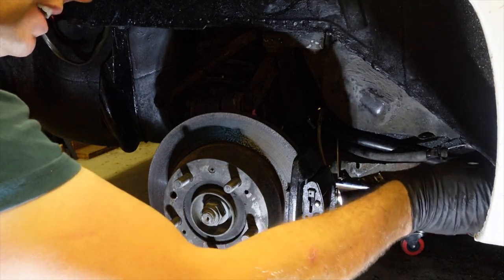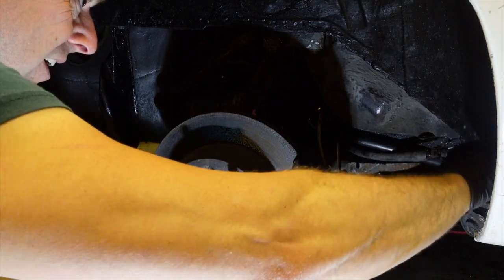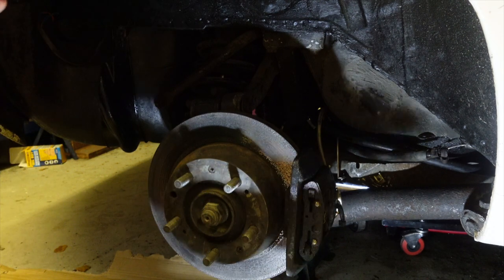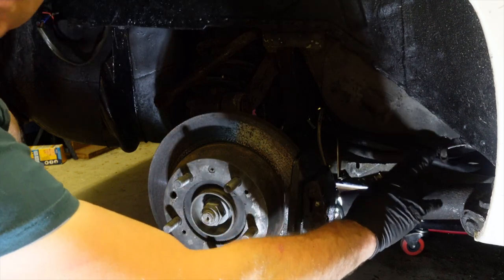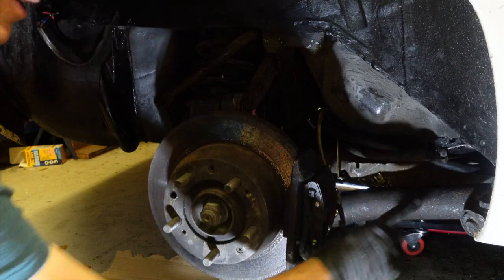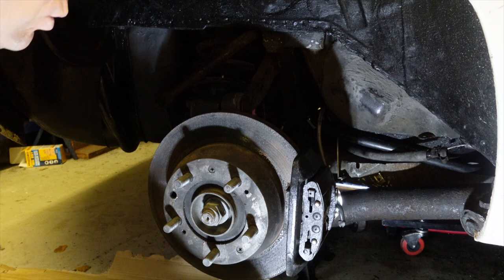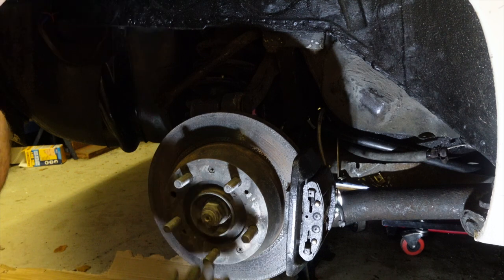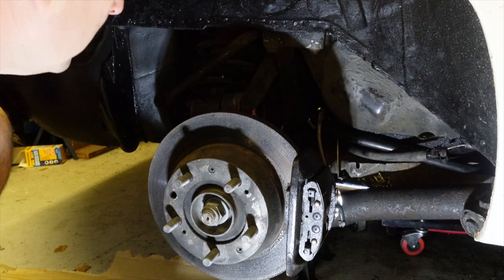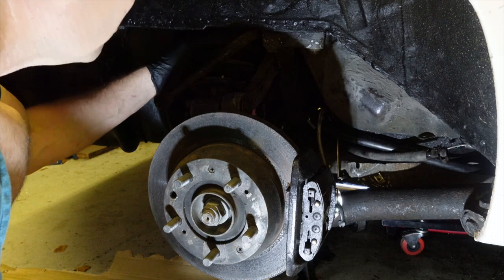I mean, the noise really sounds like a pipe or something banging against the bottom of the car. And I can feel it. The weird thing is, if I put my hand on this, this is the other end of the handbrake cable. On the inside, the tube that the handbrake cable comes through protrudes into the cabin. If I hold that, I can feel it tapping against it, like bang, bang, bang. So it's somewhere here. But it could be this suspension strut as well, just as easily.